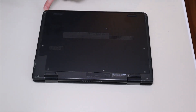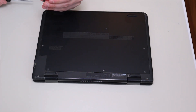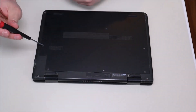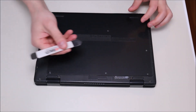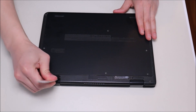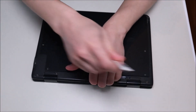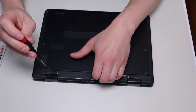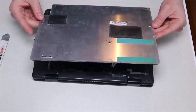To get this piece of rubber out, I'll take a small flathead screwdriver and just stab it right down in there, pry it out, and try not to damage it too much. These are usually just held in with double-sided tape — they'll pop back in as long as you don't damage them too much. After taking out all those screws, we're going to take our flat pry tool, go across the seam and pick it up. You may find that some screws are still screwed down a little bit. There we go — and that comes off like that.